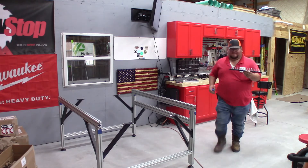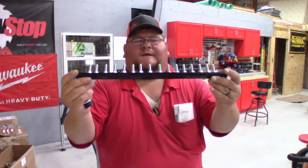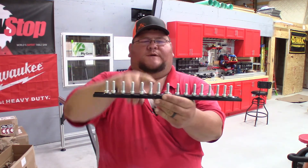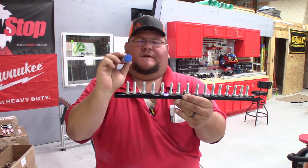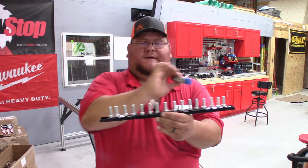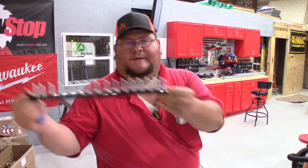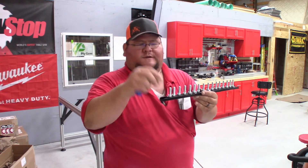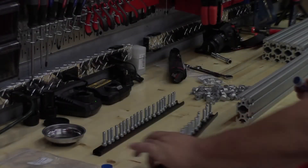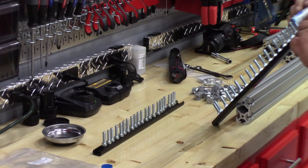Here's a little tip — you can pick these up very reasonably. All this is is a magnetic tool holder. You can go ahead and just put your bolts on there so you don't have to fumble around. You can go through and wipe your medium-grade Loctite on there and have them ready. It'll help out and you can just take it right there where you're at once the Loctite is put on.